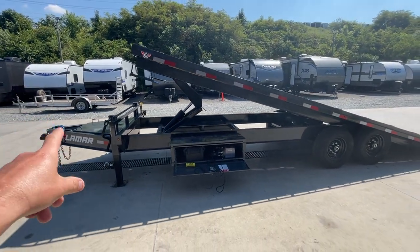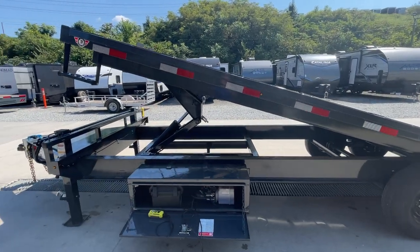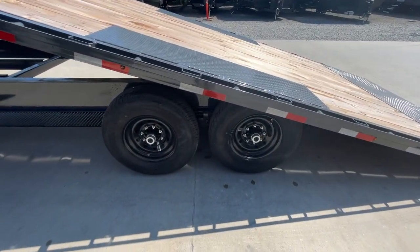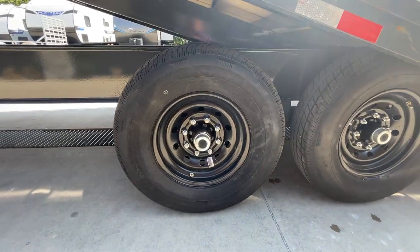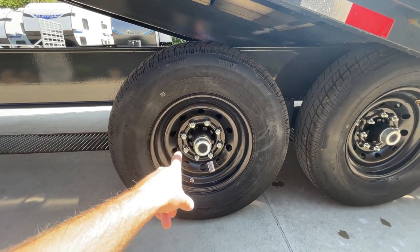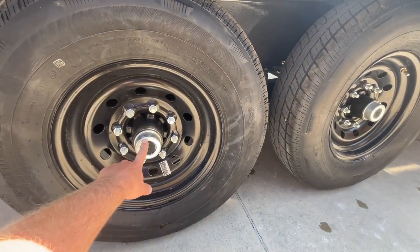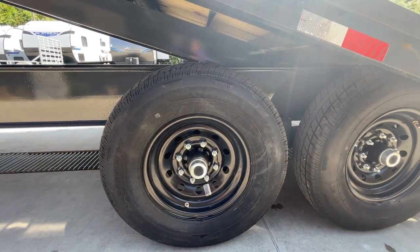So to recap — dual jacks, front box, side box, 110 volt charger, scissor hoist upgrade, heavier bed frame. The trailer has a charcoal look with black wheels, which we think is a nice look. Pretty typical on wheels and tires — it's a 235/80R16 10 ply radial tire. A little bit heavier in the studs, these are 9/16 where you'd normally see a half inch. Typical easy lube hubs — you can service your own bearings, pull that cap off and there's a grease zert behind it.